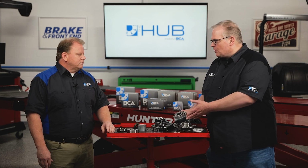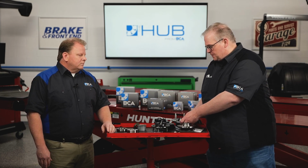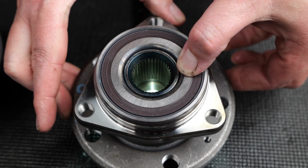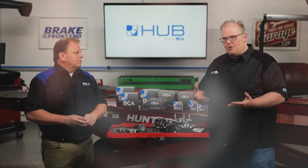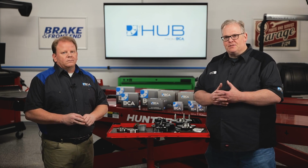Another question coming up, what about the torque for the axle nut on this one? Is it anything special with this one? Well, like you said, it is an instant torque, but that's not anything that's really new to the automobile world. It is designed into the bearing preload and the specifications on the inside. From my experience, the most difficult thing with this is actually preparing the vehicle to install the wheel bearing. There are just a couple things the technician needs to remember.